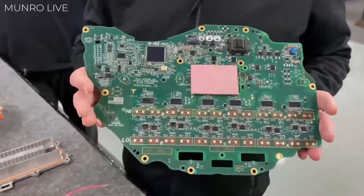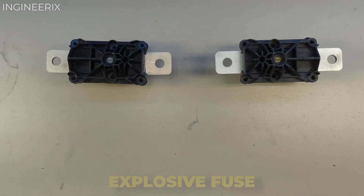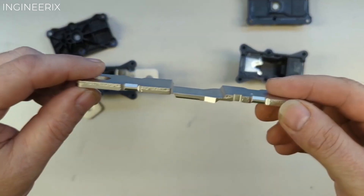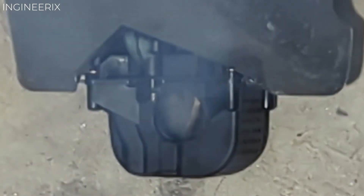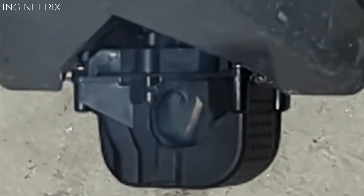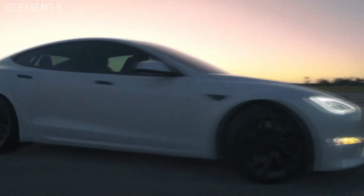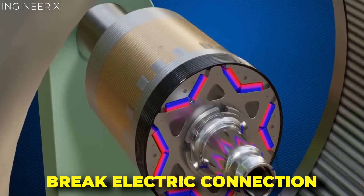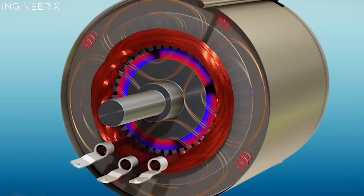The small modification to the Plaid inverter board is actually an explosive fuse. The fuse is actually a little bomb that will fire two pushers straight out that will physically break two of the bus connectors that connect the power from the inverter to the motor. If something catastrophic takes place to a Model S Plaid, this explosive fuse will basically break the electric connection to the motor and make sure that the motors go completely dead in an instant.